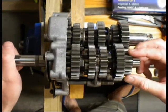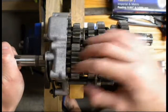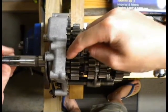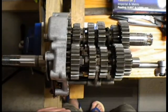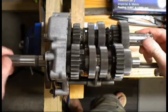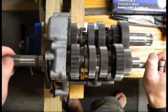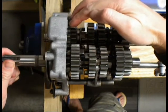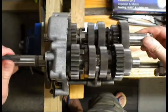This one here is splined on — you need to pull that off to get all the other gears on. But this one in here, which is first gear, is actually machined into the shaft, so that can't be changed — you've got to change the whole shaft. Okay, we'll go through the gears. Currently in neutral — I can hold that still. First gear is one down. That's first gear. This dog has moved across to lock that idler to the shaft, so you've got that gear pair locked — that's first gear.